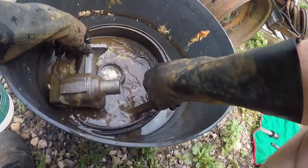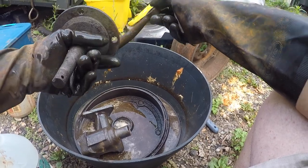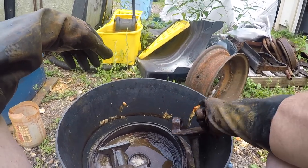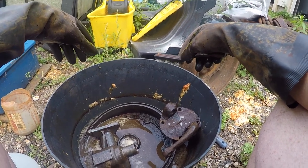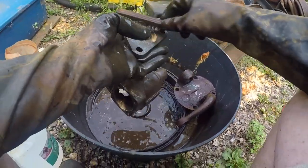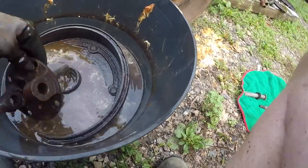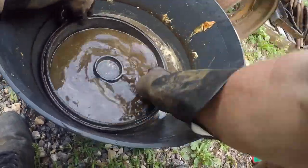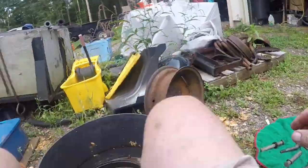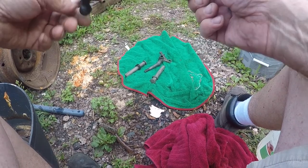Here is what I'm really interested in — see that clean metal. It's pitted but it's clean. What's going to happen is where these nuts are, that foamy stuff we saw when we first opened this up — eventually where these nuts are there will be little dollops of foam working on those nuts. Clean metal — getting it down to clean metal. It's a little time consuming but it works, and we're gonna leave them in for days. I'll have to get some more vinegar. These parts are all going in. We really need to finish this bad boy. This was totally rusty and you can see all the rust coming off.